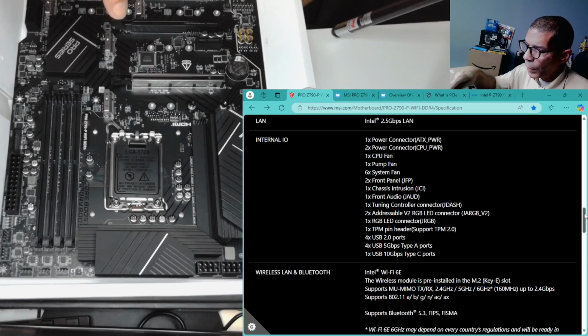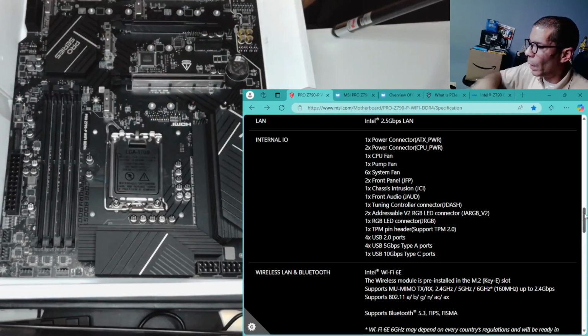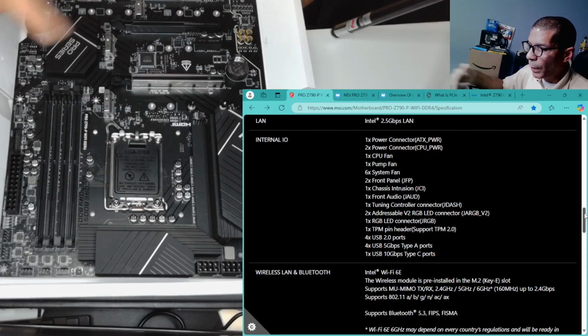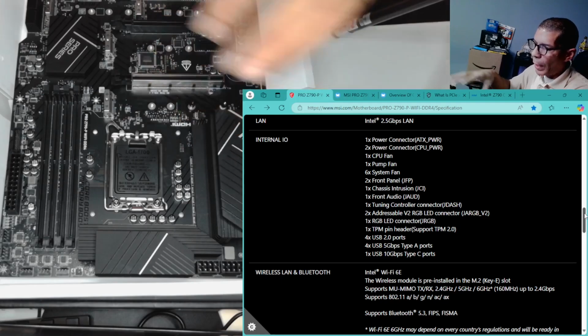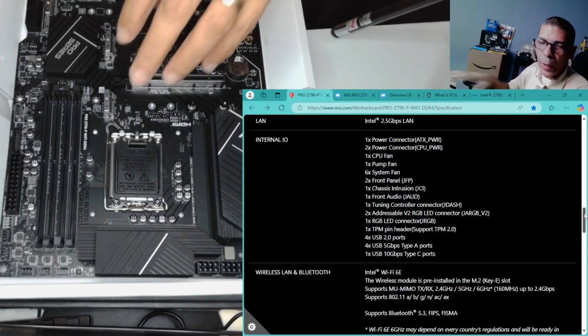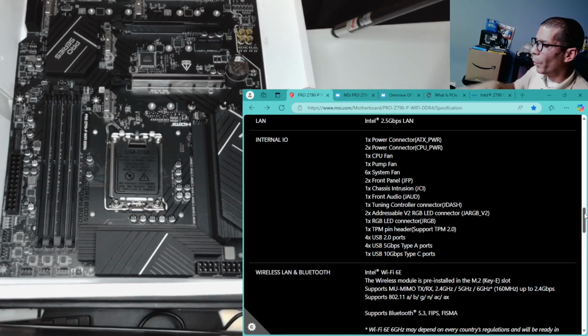the draw and the heat that your CPU will be producing, depending on the load. Because remember, this is a gamer's motherboard architecture, so you want to make sure that your motherboard recognizes those things. So it doesn't do any good if it speeds up the fan, but it doesn't speed up the pump. Yes, you can buy a standalone cooling system that will regulate all that stuff for you, of course. But this motherboard has that in it.